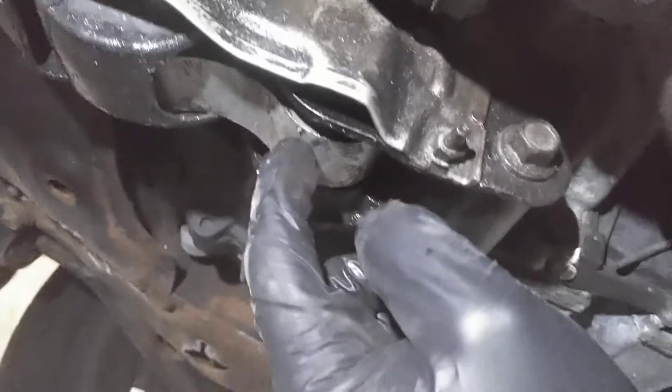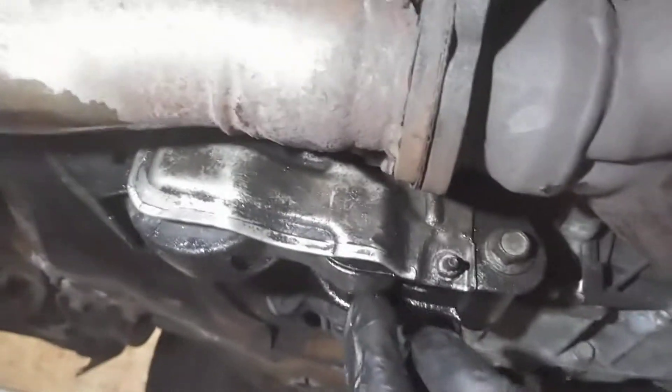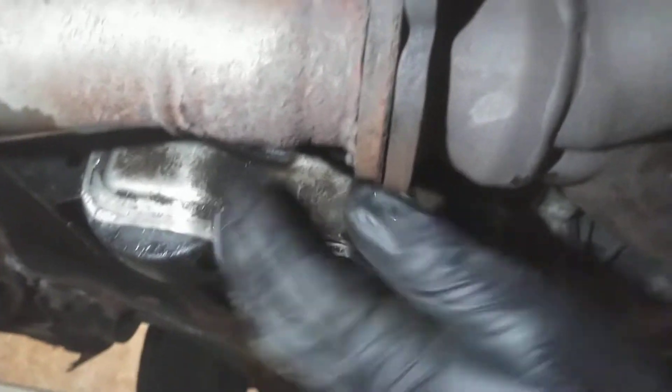What's happening is that the bolt inside of this — the bushing is gone — so the bolt is actually moving a good half an inch front and back. So as we're driving and the motor's getting torque on it, it's moving backwards and forwards, creating the U-joint to be going backwards, or the drive shaft going backwards and forwards on the car.